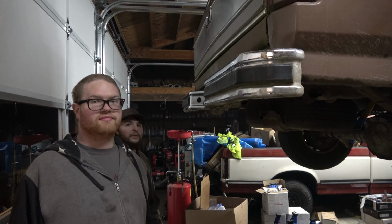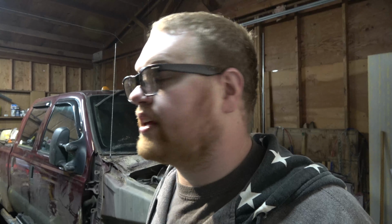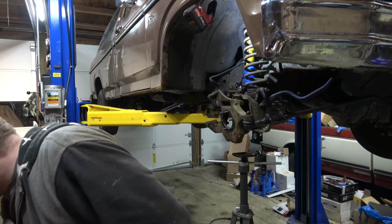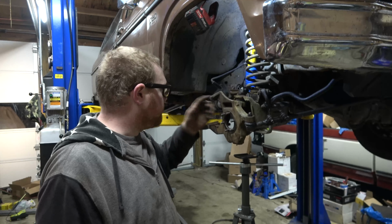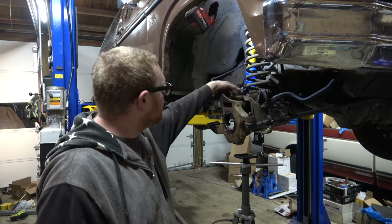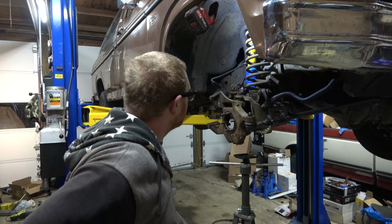Well, as he gets his eyesight back, I'm going to go put my steering knuckle back in. I've been kind of bullshitting, and I have my job almost done, whereas the other side took me 5 hours. I've got new ball joints in. I forgot my bushing kit for this, so I was able to take the factory one and just flip it around, and I think that will give me my